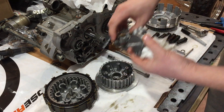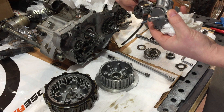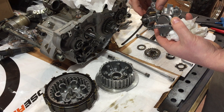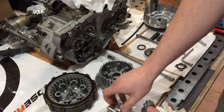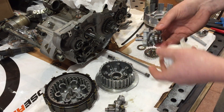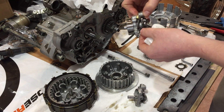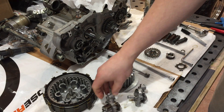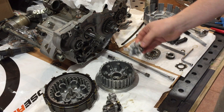To swap the rotors over, just take the ring off the shaft and swap your inner and outer rotors. Take a close look at them — if the engine has been blown up or had debris through it, the rotors will be scored and scratched and should be replaced. These are in beautiful shape because the engine is really low hour. Three 5mm bolts hold the pump on; one is a little longer and lacks the yellow zinc coating of the other two. You also have a dowel pin and an O-ring for the suction side.